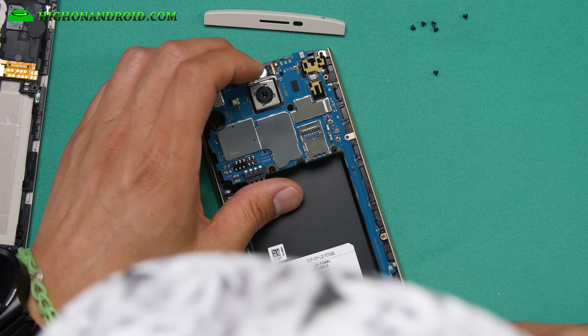That's the motherboard. On the back, if you need to replace the front cameras — the two cameras — you can go ahead and pull this out and replace it. If you need to replace the main camera, you can also pull this out and replace it. You're gonna have to take out this plastic adhesive piece before you can get to the rails — just pull it out, that's all you need to do. Now the steel rails just pop out — slide it up a little bit and it pulls out like that.